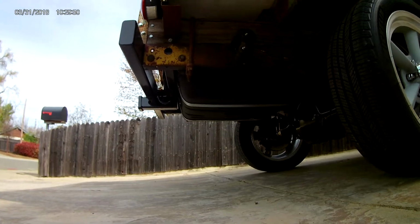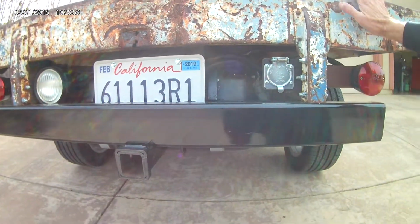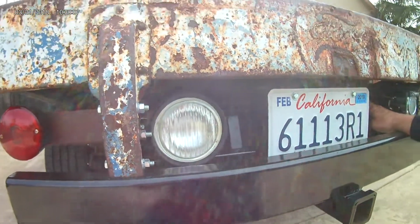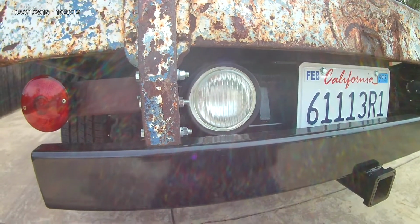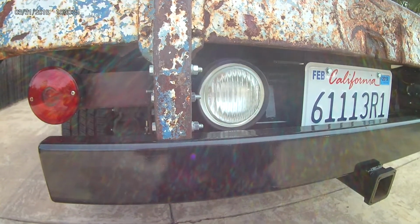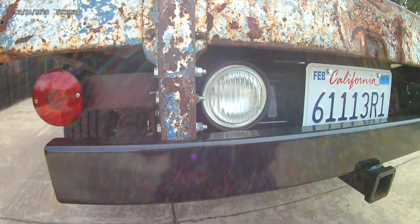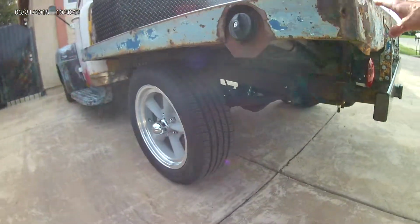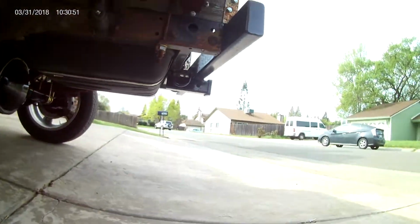Using a Tanks gas tank for a 51 Ford passenger car. I don't know if we can see it inside there, but that's the pressure transducer here on the back side of the fuel tank. Actually, since we put this thing together, I think Classic has got a converter where you can change the output for your gauges. The aftermarket gauges use a 33 to 240 ohm fuel sender, and the Ford uses a 160 to 10. So they're inverse, plus they're a different resistance factor. So it's running two fuel sending units in it, but you can see underneath here, charcoal canisters are in place, all the plumbing is there. Got an equalizer hitch on the back.